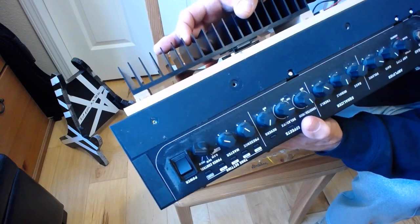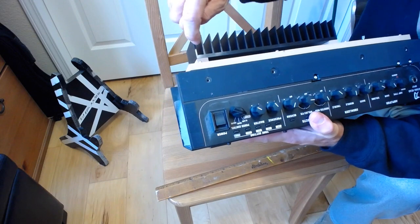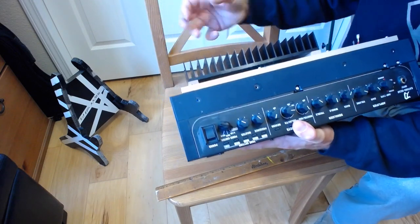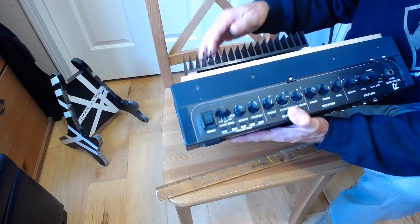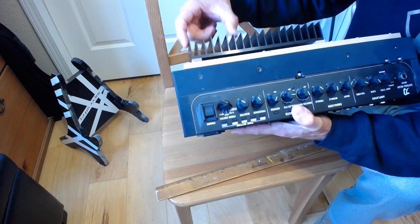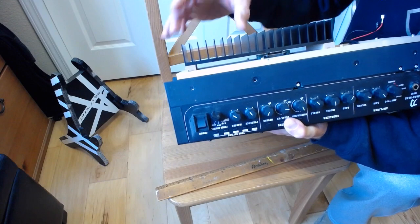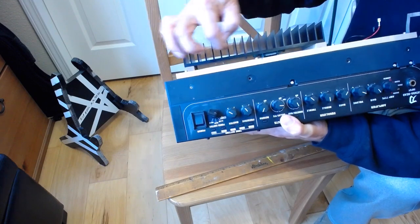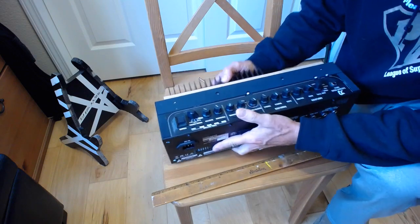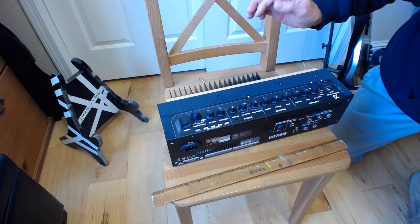All right, but look at this. Now, you still could do this, but you'd have to cut these fins away to allow for the magnet of the new speaker to sit in there, and I don't think that would be such a big deal. This thing is so massive, and these fins are so far away from the heat source that I really don't think that would be too big a deal. You could cut these back. You need about an extra inch of clearance. Or you could mount the speakers with offset rings.